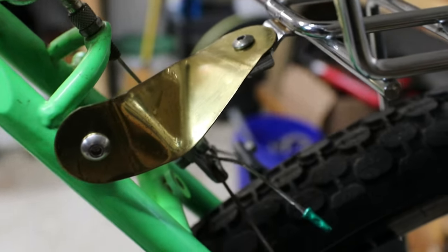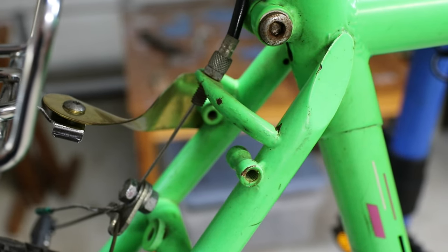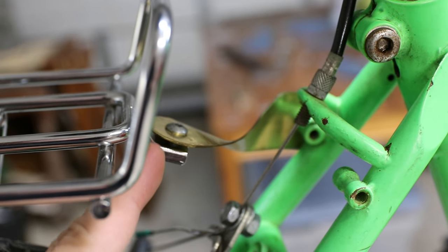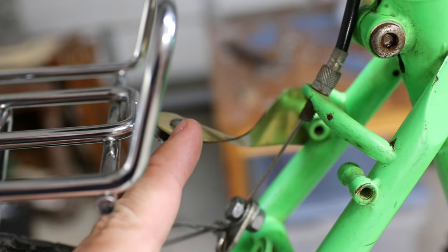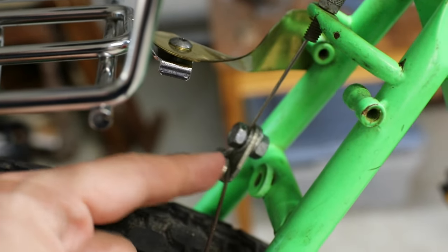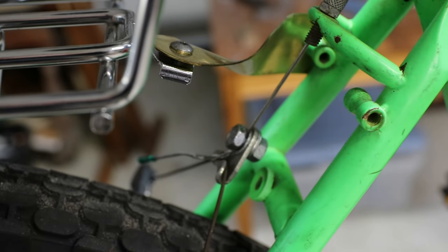Although it does work like this, I think having two — one on each side — will make it a bit stronger. Just to be clear about what we're doing: we need this rack where it won't slide forward and backwards. The weight is supported down here, but the forward and backward motion is locked at this point. We basically need something to connect to its existing mount here to here. There's other ways you could do it. There is a mounting point right behind the cantilever brake cable setup, but that's a little bit difficult to access. So instead I'm going to use these mounts here, which is exactly what they're designed for, and by doing that I can go around the cable.